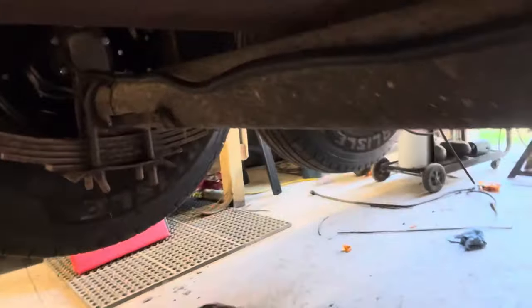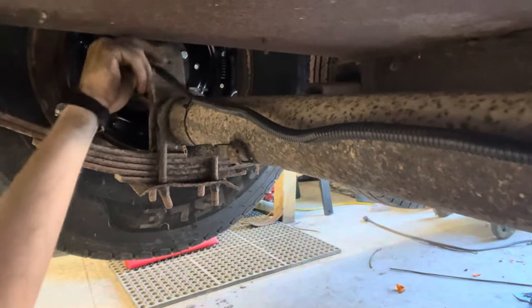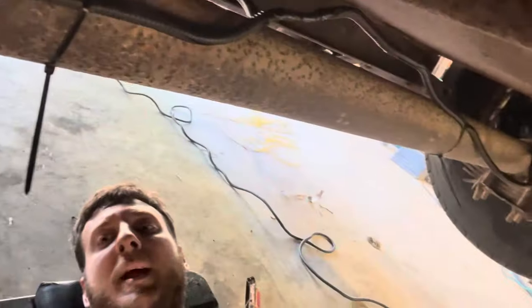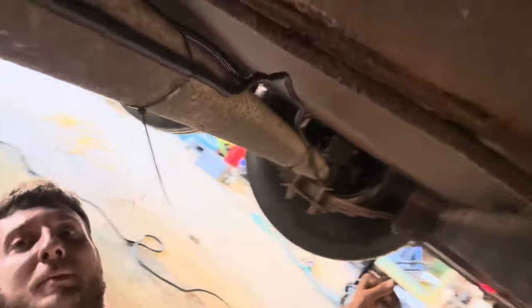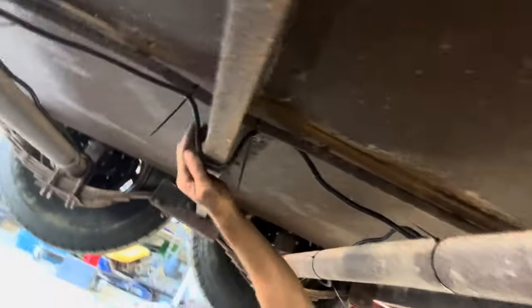Here's how I have it connected: you can see the two wires coming off. I leave myself a little loop but I don't want it getting caught in the springs. It comes down to the center, ties into the front axle, and keeps going. The wiring goes up and over into the axle, spliced in the middle, and travels all the way to the front of the trailer.